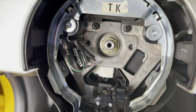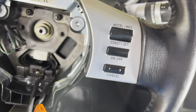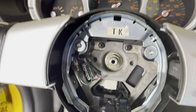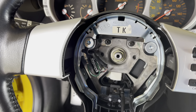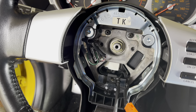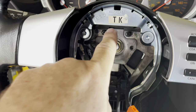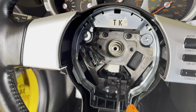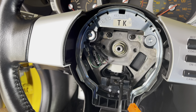Now all I've got to do to get the steering wheel out — there are a few other steps. I've got to unplug this connector on the left for the instrumentation and get this bolt off. You can see the little alignment line — make sure you get it in right, start with everything nice and square. Don't move the steering wheel around; you don't want to mess up the spiral spring or clock spring that's in here for your turn signals and electrical connections — that'll give you a real headache. I'm going to get a big socket on here and break this loose. The trick is to take the bolt off but not all the way, then gently tap on both sides of the steering wheel to break it loose. Leave the bolt on so you don't hit yourself in the face, and once it's broken loose take the nut off and remove the steering wheel.